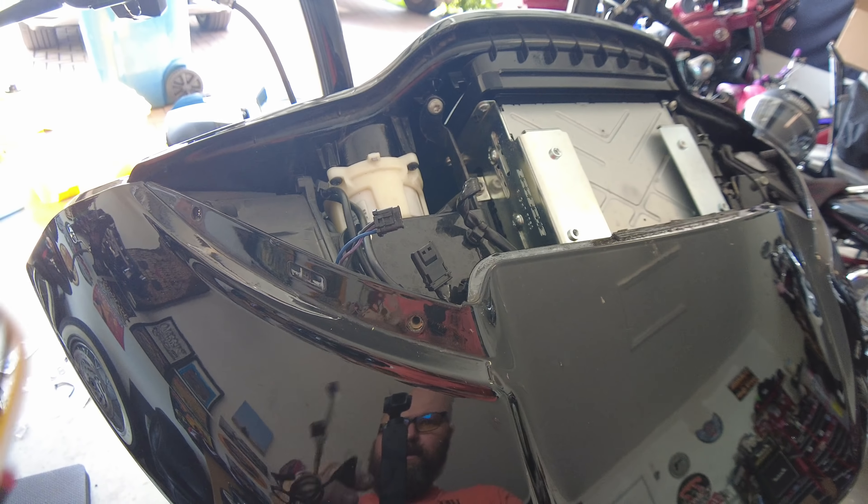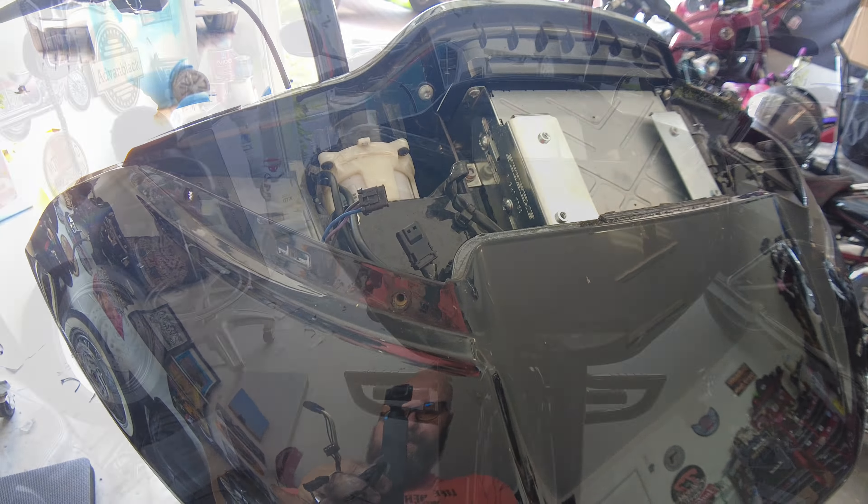The fangs are going to plug in line here and then they just go on top of the windshield before you screw it back on — it's kind of idiot proof. I'm going to try and do a better job of a how-to on this because I really think these are cool. They're not crazy expensive and it's a nice upgrade — even if you don't work on your bike at all, you can do this. When I took the windshield and cowl off, this plug was sitting right here — that is your turn signal. One side is the one on the fairing and the other side goes to the bike. The light package at one end has a pass-through — a male and a female. So this end plugs in there and this end plugs in there, and that's it.